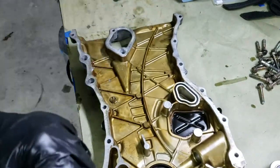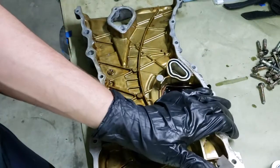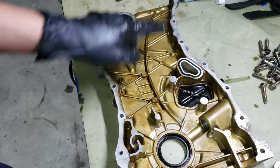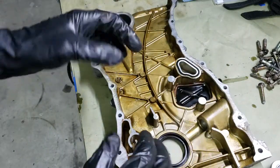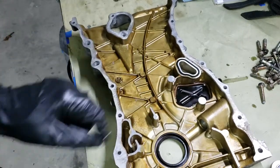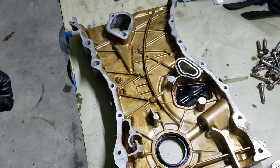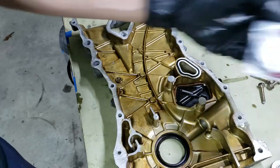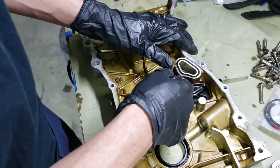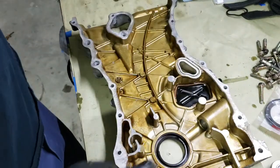Alright, we got our timing cover — it's already been along and cleaned up. We'll go back and go over it a little bit. This has no gasket, so you put Honda bond or gray silicone around all these edges and around here. You've also got a couple seals — you got your crank seal — so you definitely want to change these while you have it apart. You can tell how flat and hard these little o-rings are, which definitely could have been a problem at some point.